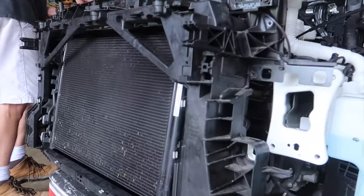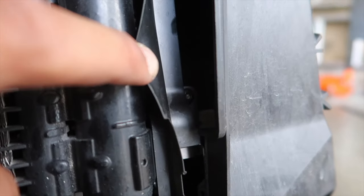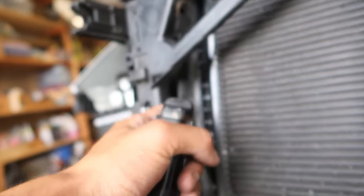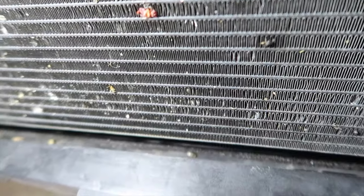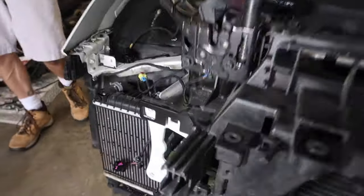She's basically in — just need to press these bad boys on. I broke my 3mm bit off in there, but all the rest of the bolts are in. Put the plastic bits back on — don't forget those. I went ahead and added some expanding foam under and above the intercooler to help prevent air from passing underneath. You can get it at Lowe's for a decent price. These little guys should help keep air from going through the sides. Squeeze this bad boy back together and from there it's just nuts, bolts, some clips, and intercooler hoses — pretty easy.